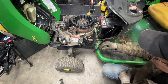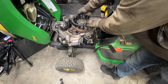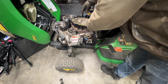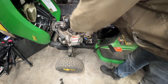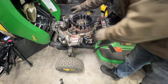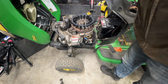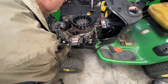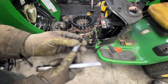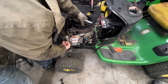To get this motor running, but we'll see if we can get it running. It seems to only have compression on one cylinder. Turn it right there - so right there the compression stroke starts. Two full turns again right here - it only has compression on one cylinder. So we're gonna have to take the spark plugs out, figure out which side has compression or not. Let me stick my finger in here and see if I can get compression coming up - I got nothing.